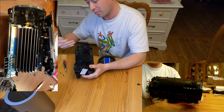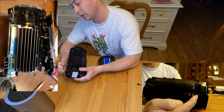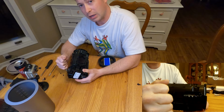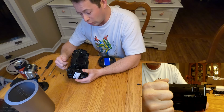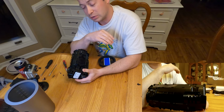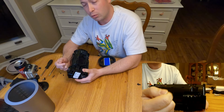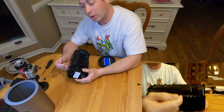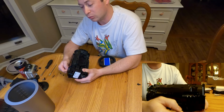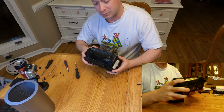And so starting at the top of the unit, that's L1, and then it's L2, then it's GPS, then it's L3 and L4. And some of the instructions online will tell you to plug it into L3 or L4. What I will say about the antennae, the testing I've done, it doesn't matter. It doesn't seem to matter if I use 3 and 4 or 1 and 2. But you don't want to mix like 1 and 3 or 1 and 4 or something. You want to use the 2 side by side.